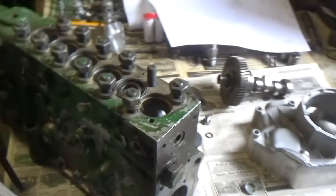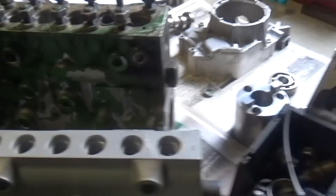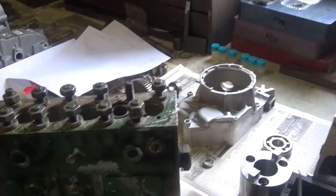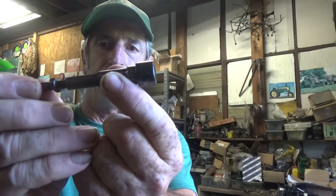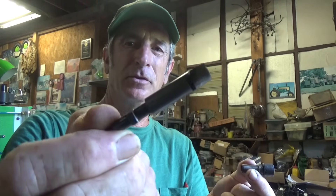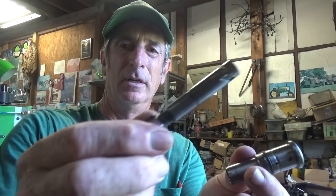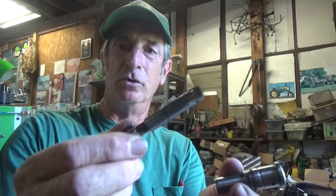You can see it's a little different in size, but it's really not the outside of the housing that makes a difference - it's what's on the inside. In the A pump, the smaller of the two pumps, you have your pumping element here. This is called a plunger in a barrel. In your P pump there's quite a bit of difference in size - it's a lot larger, everything is bigger, the plunger moves farther and can move a lot more fuel. So we're hoping to get some more fuel by going to the P pump.